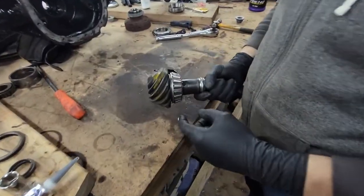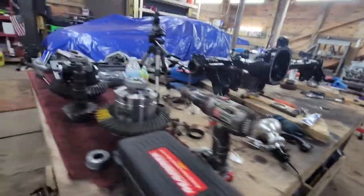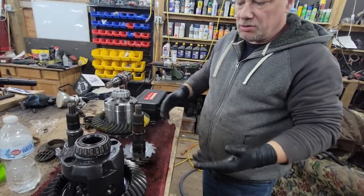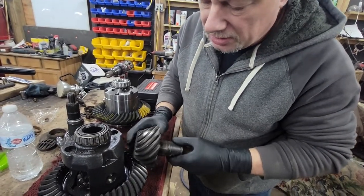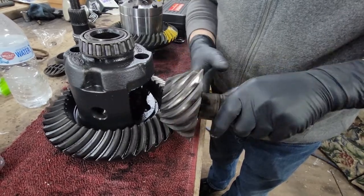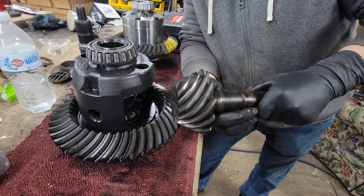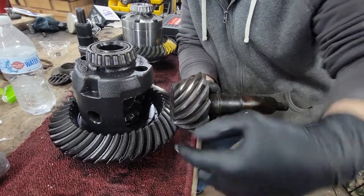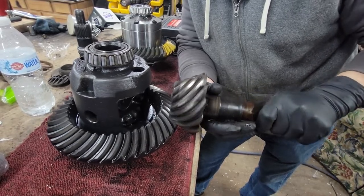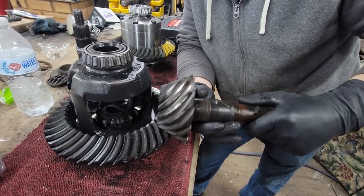When we set up our ring and pinion depth, come over to the old one and I'll show you what I mean. There are tons of videos out there on this and you can get the idea too. The way this works is these gears lay in like that — you can see how it turns. Now when you set the ring and pinion gear, what they're telling you to do is check if the gear is sticking out too far. You can see where the gear is here and the ring is not touching the teeth — hear how noisy that is as it turns? That means it's not where it belongs.